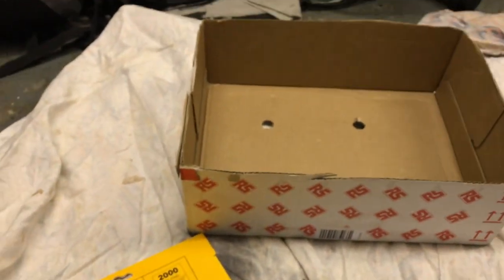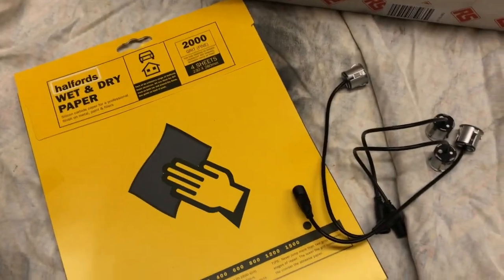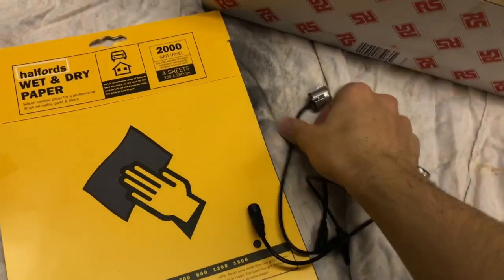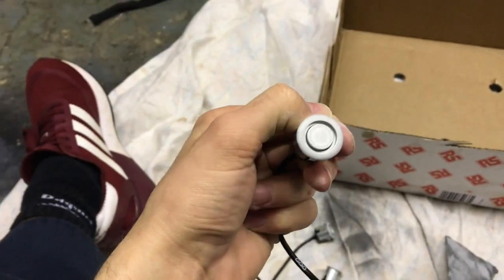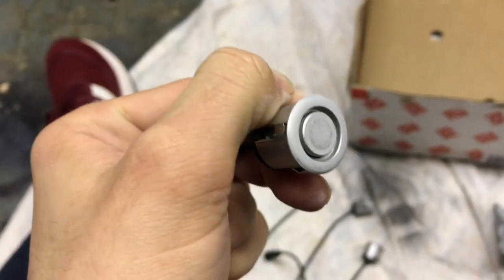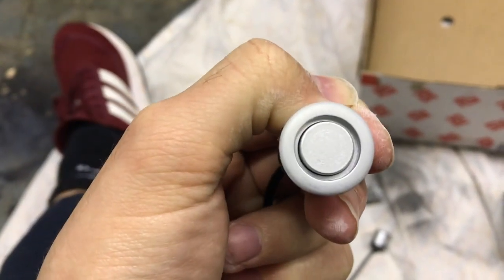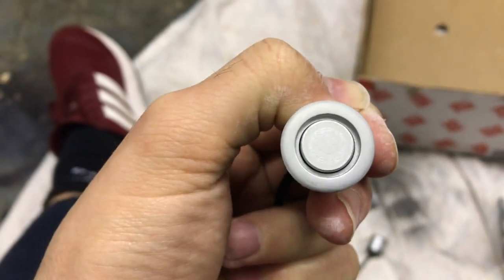First, I'm going to do the wet and dry sanding while it's dry, just to key the surface so it's nice. I'll finish with the 2000 grit — you're aiming for a fairly matte finish. Since these are small you don't really have to do it too much, just enough to get a good surface for the primer to go down onto.